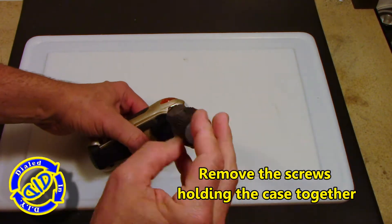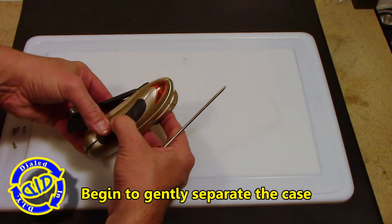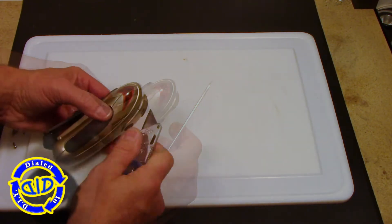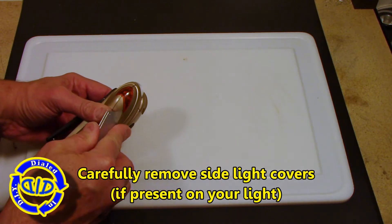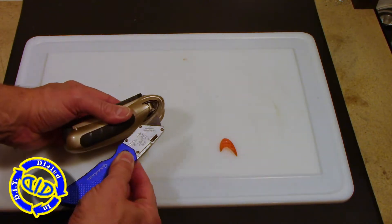This particular kind of light is quite easy to work with, because all I have to do is remove these four screws from the back and then slowly start to separate the case. But you'll notice it stops towards the front because there are some flashing lights on the side that have these little amber covers on them. So I'm going to carefully start to pry these out so that I don't break them, because I want to put them back intact.